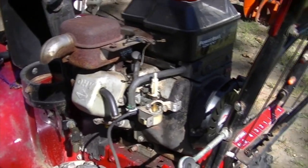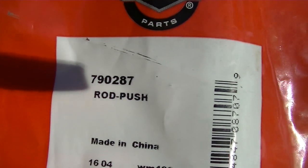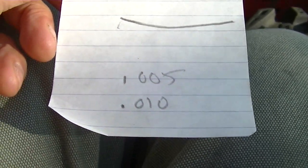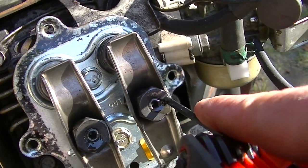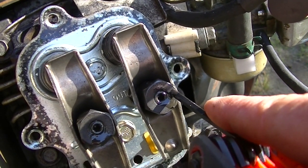I really wanted to do this because it's supposed to rain tomorrow and I didn't want to leave everything open. I got the new push rod — put it in and now I've got to adjust the valves. The settings are 0.005 inches for the intake and 0.010 inches for the exhaust. What you've got here is an Allen in the center that raises the height, and the outside nut tightens it up once you've got it set. It's a little finicky, so I'm going to try to show you after I do it.